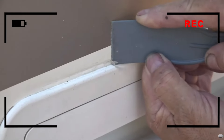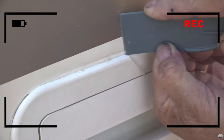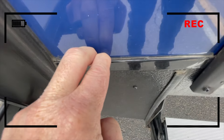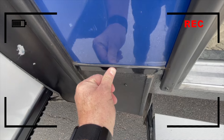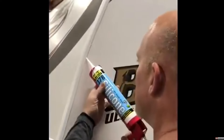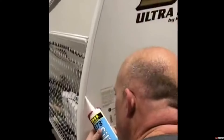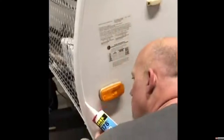There's a ton of things on these coaches that need to be sealed — awnings, awning rails, awning mounts. So when we're recommending to you to do a body reseal, we're going to scrape everything off that's presently there. And if anything we see or think is loose, we're going to attempt to tighten it up or add additional screws or fasteners or staples or whatever is required to get it secure. Then we're going to go back and reseal any open penetration on that unit.